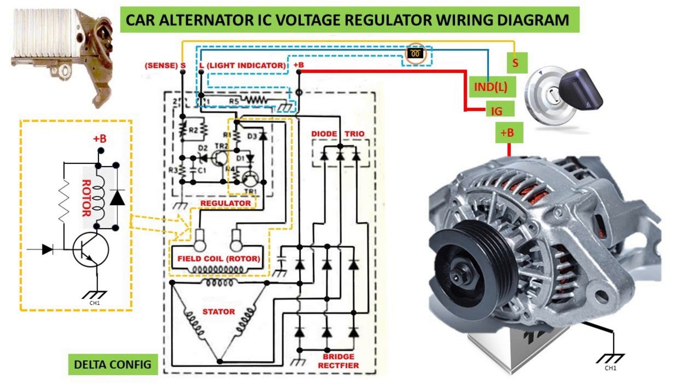With all that going on, manufacturers went even further. Since the federal government likes fuel savings, they came up with the idea where the engine controller actually cycles how much power the alternator produces. And that is your Variable Voltage Control System. It sounds like a pretty good idea in theory — the problem is, theory often doesn't make it to the real world very well, and in my humble opinion this is one of those cases.